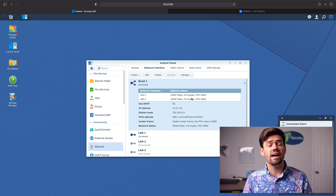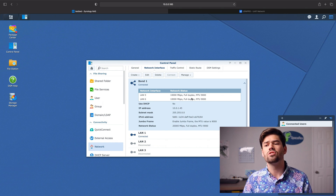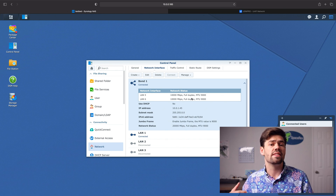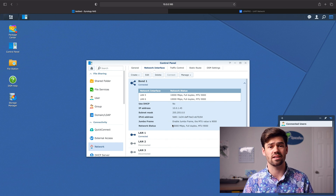From clients I've worked with, I have seen people saturate three different 10 gigabit connections all at the exact same time with video editors running — we actually ran Blackmagic Speed Test on three different NICs. These cards and these NASes are capable of it, at least the higher-end ones. Really, what it's going to come down to if you are enabling jumbo frames is that the bottleneck is actually going to be your spinning disks most likely.